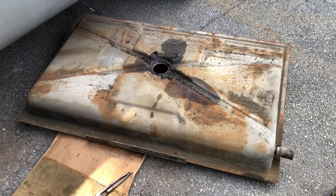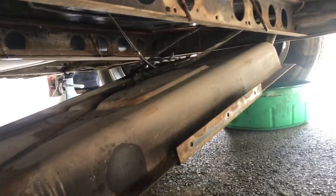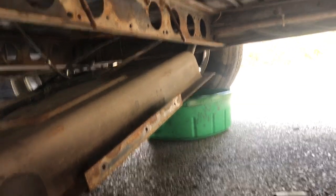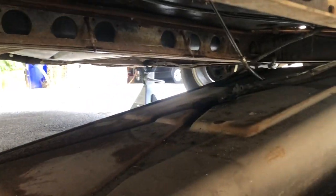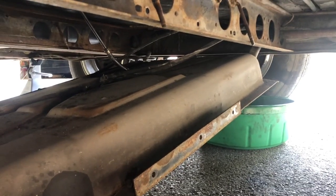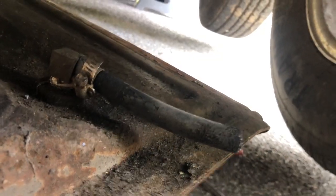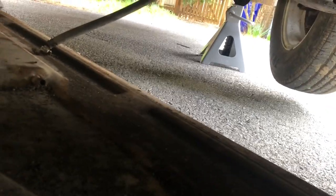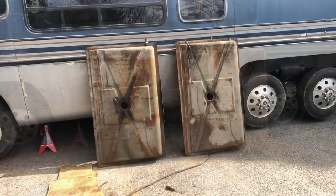It looks like you definitely have to remove the front one first so you can get that L-bracket off. I put a bucket under where the filler hose is, just so when it drops, the tank would be at an angle and the fuel would be down here. I can see there's a vent line I'm going to need to take care of, but this one's coming out just as easy as the other one. I'll grab my pliers and wiggle that back and forth and pop that filler line off. I just cut the line that goes to the generator up there — it's definitely the original line, it's kind of hard and brittle. I took the vent off and now we're going to slide this tank out. And there you have it.